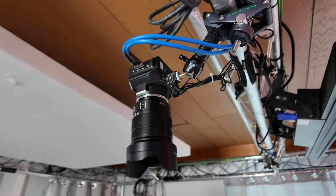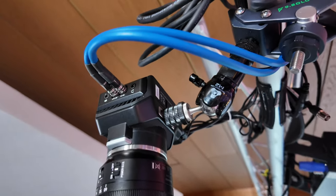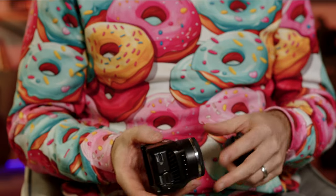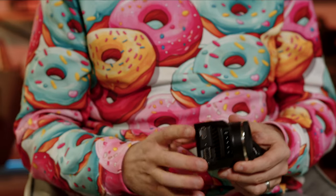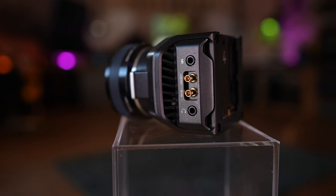This had a serial port with lots of cables hanging, pretty annoying, and I will show you in a sec up there. It has dual SDI in and out for program and remote. Headphone out, little mic in. HDMI out. On the newest version, this is replaced by just a 9-volt input, but it also gets a USB-C, which means on the new version you can actually record in 4K on an external hard drive like the one I had earlier. Put it on there with a cable and you can record these ISO workflows that we talked about, where you instruct the cameras to record even though you're working in an HD environment.